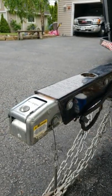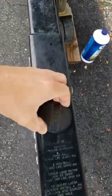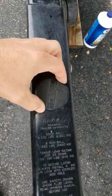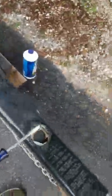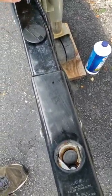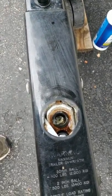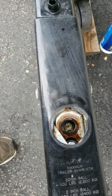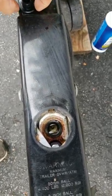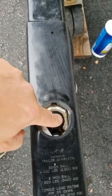I let him know that. I opened up my master cylinder — you can see this plug here, I popped it out, grabbed a screwdriver, checked my fluid — and it was bone dry. It has some fluid in it now because I'm trying to see if I can salvage this master cylinder. I have my doubts.